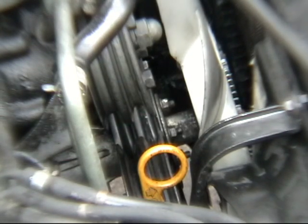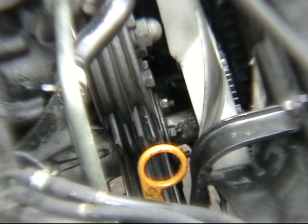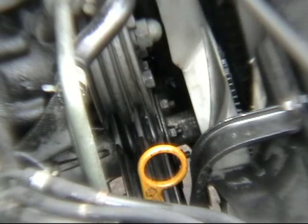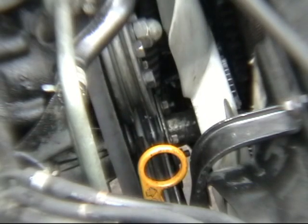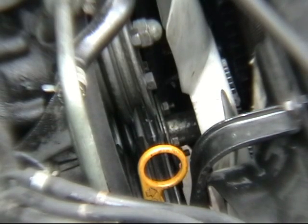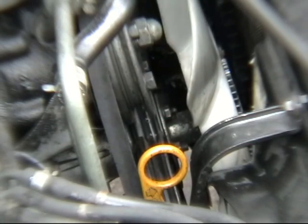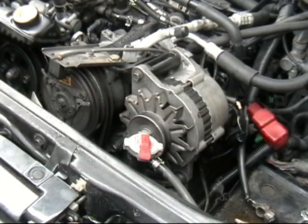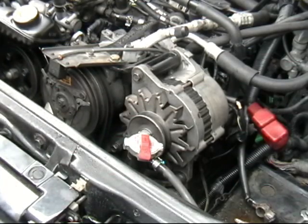Okay, now we've got that on there, ready to install our belt. We are going to install the shorter belt first because it rides on the inside, and then the alternator belt rides on the outside. So I'm going to start by slipping my belt over the fan, then come around the back side of the crank pulley, over the power steering pump, and around the reluctor for the AC. You can get the belt to slide through behind the reluctor, but this cover plate is designed to come off if it gets in your way. It was a little bit of a pain to get around the pulleys — by the time you get it to the back side of one, you're stuck in the groove on the front — so it's a little trick to rotate the pulleys to walk it on, similar to resetting the chain on your bicycle.